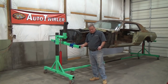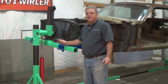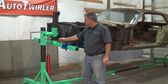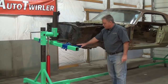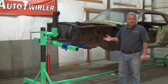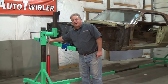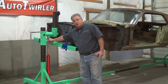Three out of the four models that we have have hydraulic jacks on them. It's a three-ton long ram jack that comes up into here. We also have a five-ton air-over-hydraulic as an upgrade. That allows us to drop this whole unit down. We can bolt onto the car while the car body itself is on jack stands or one of our body carts. Once we get it up to the working height that we want, we put this bolt here in the outside post to take the weight off the hydraulic jack — so if we want to sandblast or even paint, we can just go ahead and remove this altogether.